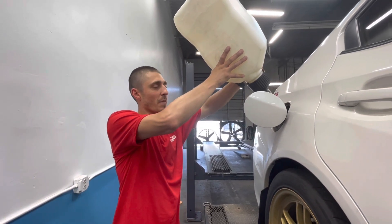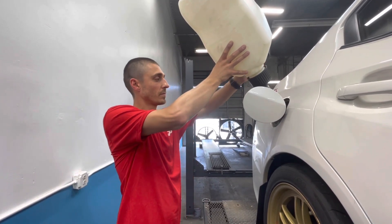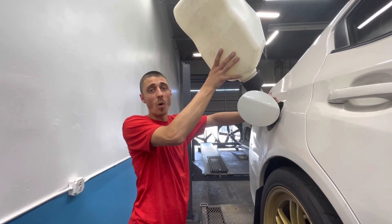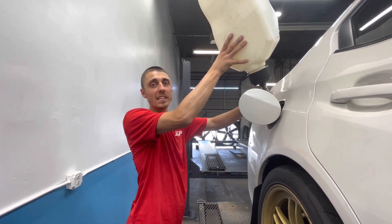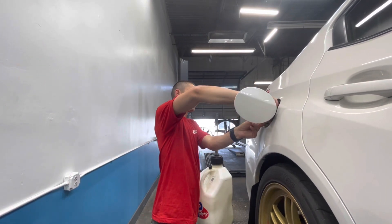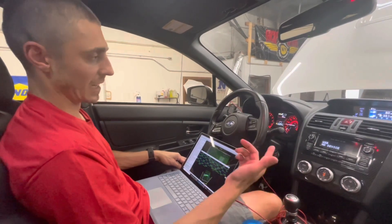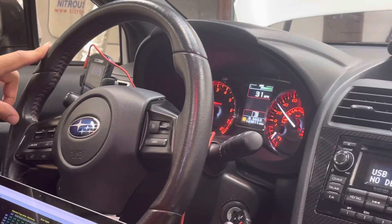We're actually using e98 here because that's what we have in the shop — you won't find that at most pumps, but it lets us bring up our mixture more quickly. If you're wondering how to know your exact ethanol content, you can always get an ethanol content analyzer gauge. If you don't want to go with true flex fuel and convert to ECUTek, you can put an ethanol content analyzer and gauge on it so you can see exactly what ethanol content is traveling through the fuel line. Let's let that mix up and then do a pull. We've got the e30 in the tank, all mixed up, and our e30 off-the-shelf map flashed — let's do the dyno pull.